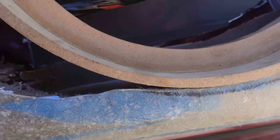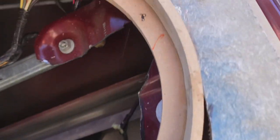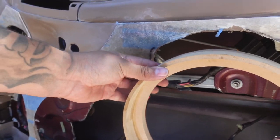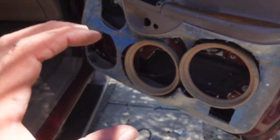It clears — that one clears, and this one, the only part of the door is that part but it does cut inside the door and it's somewhat countersinking the ring, and that one's going to clear too. It barely clears by like a paper, but it clears. That's why it's critical to mount the ring so the lip barely sits on it — anything past that it would not clear. Squeezing three tens into a Ford F-150 like this one is a pain, but it's doable. You just have to really think about it and not let anything scare you.